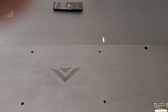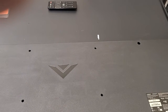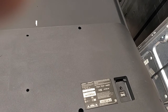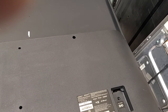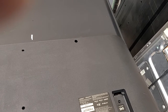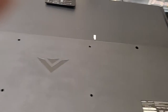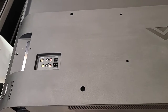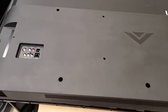This was a patch — a crack patch rather — to make something work. The customer brought it in and the complaint was the unit was coming up with nothing on the screen. They could hear sound, and every now and then the picture would be there, and once it starts working they said it works fine. Unusual — it doesn't sound like an LED problem. What it turned out to be is the backlights do come up but there is nothing on the screen, so the image doesn't get there — probably a bad T-con or whatever.